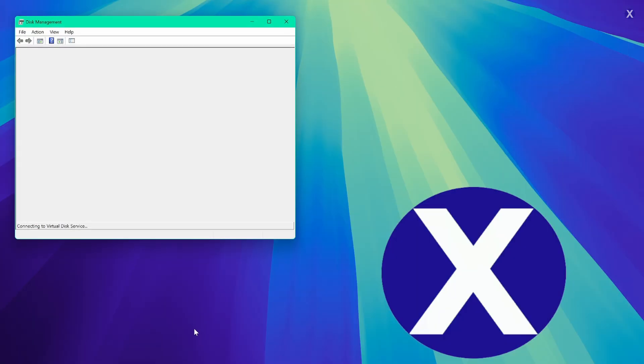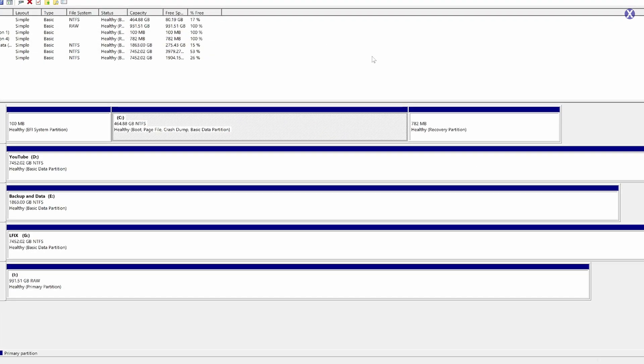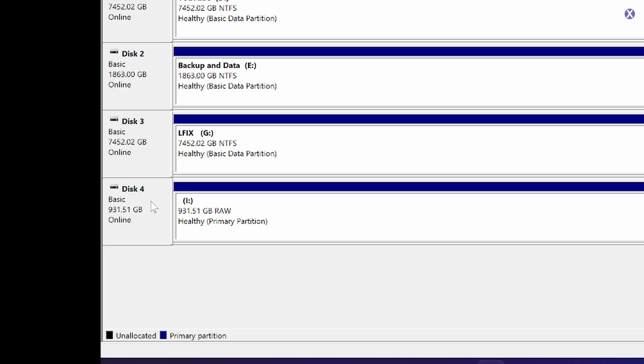Let's go ahead and check disk management. Disk management is just a way of managing disks through Windows. This is a one terabyte drive, which is correct — this is a one terabyte SSD drive. And we see it's in a raw format. A raw format is a corrupted partition. It does recognize that there is something there — you can see size — but you can't access the drive through Windows. It could be a format issue, an issue with the controller, lots of different things. It's usually hard to determine exactly what that is without removing it.